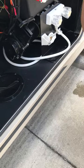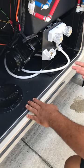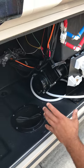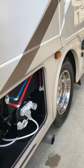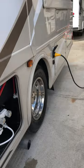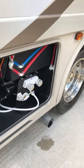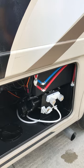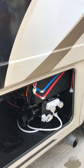So that'll be your kitchen sink. What you're going to do, when you leave here or when you get a chance, is buy a second hose. Your second hose is going to run into here. You're going to get a Y. That Y is in the middle, so those two connections connect to that Y. So this water doesn't go down? No, this is a separate connection from that. So you're going to need two hoses. We have one already. You're going to need a second hose that connects to a Y, and then a hose to the septic tank. So we have two gray water tanks. Yep. You have a galley and a regular gray, and then you have your black tank.